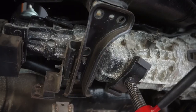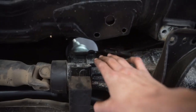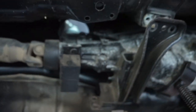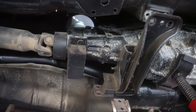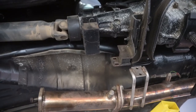What I'm going to do right now is start getting this short shifter and shift knob installed. We're under the car right now, and I have the trans mount removed just so I can make enough space to get these two front bolts out since they're a little bit difficult. Now I have to get the two back ones out, which are also pretty difficult, but it's not that hard now that the trans is lowered. The hard part is going to be hopping in the car with the car up on the lift right now.